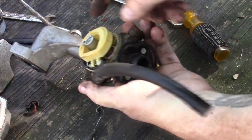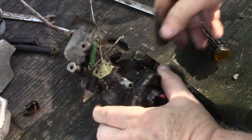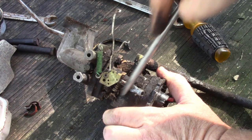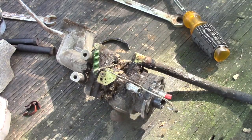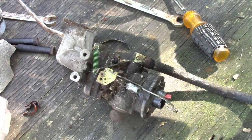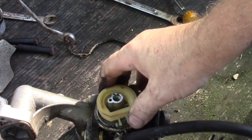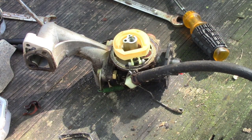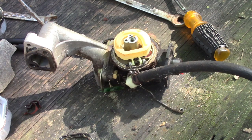The needle's moving. That primer — it's pretty much toast, you can see how caked this thing is. Everything does move but let's take a look and see what we got here. Yep, so there's the issue with the carb — besides being filthy, you can see what's left of our o-ring. So I'll take a look around and see what I got. Man, this thing is just old — the manufacturer date on this is from 1998. I'll double check, but I'm pretty sure. Look around, see what I can come up with.